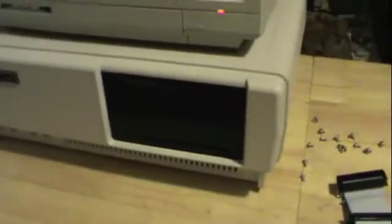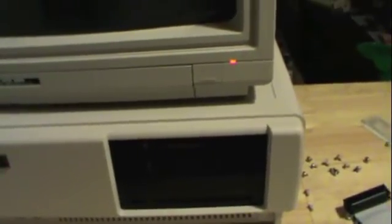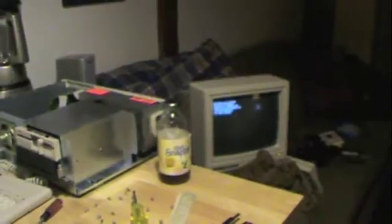I'm not feeling very optimistic about this, but let's see if it does a floppy seek. No, I don't think it worked at all. We'll go back to the drawing board. Worst case scenario, I'm going to have to put the original drive in and it'll just have to be mismatched. I found a combination that does work — the original floppy drive without the extra controller card installed works just fine.